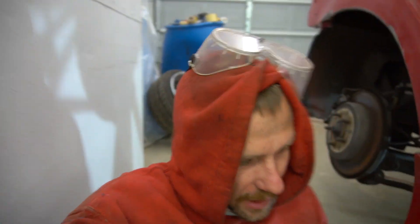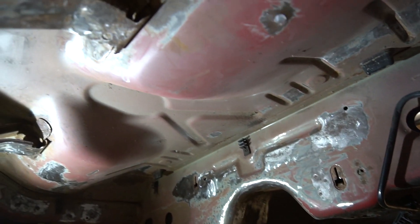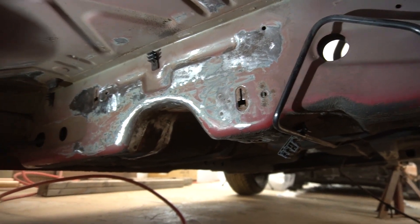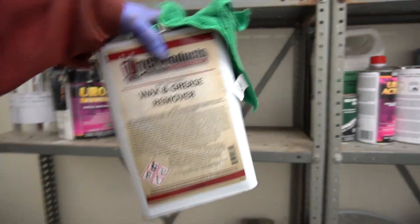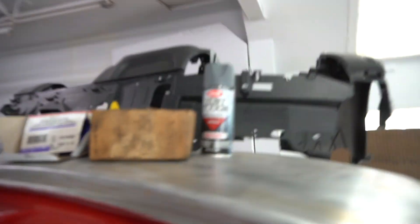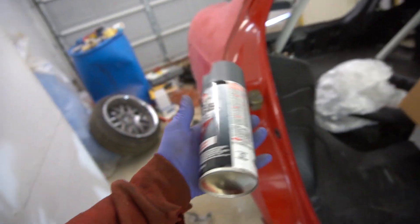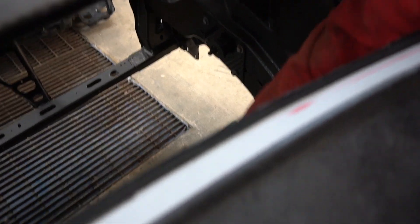I got a good amount already whiz-wheeled under there, so we're gonna take a look at it. See we can give you guys the best look possible — look at that, everything is bare metal. So what I'm gonna do is take some TCI Products wax and grease remover, wipe down the bare metal before I go ahead and take my Krylon rust tough enamel primer that I got at O'Reilly's. Before I start spraying, I'm taking this ABS wire out because we're not going to be needing that anymore.